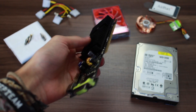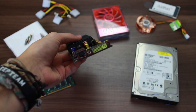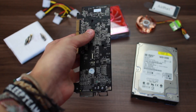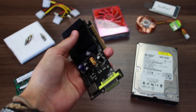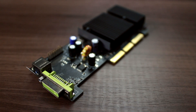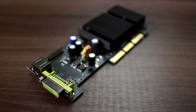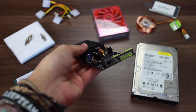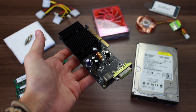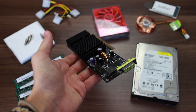Here is the GPU itself. This is an NVIDIA GeForce 6200, made by XFX. It's got 256 megs of DDR2 video memory, and most importantly it supports Core Image, Quartz Extreme, all of that goodness. This really should make running Leopard on this cube a much more pleasurable experience.